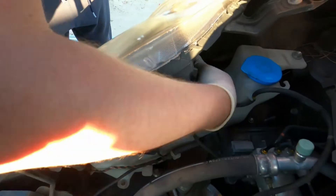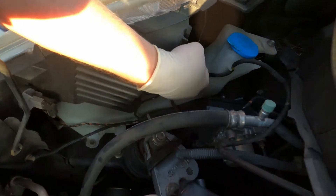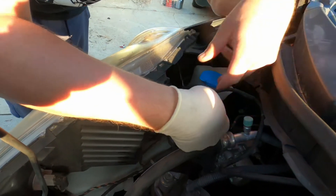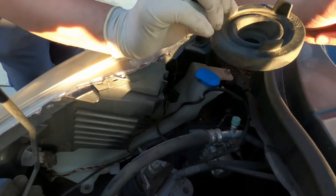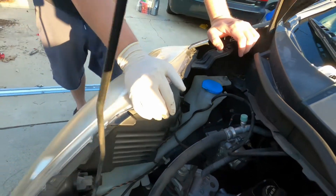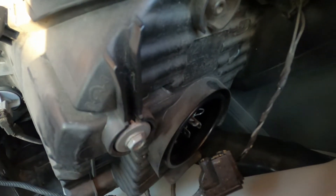So you're just gonna reach in, grab the plug, and unplug it. You can see there's a bunch of bulb grease and stuff in there. Then you're gonna grab the rubber boot and just peel it off. There's your rubber boot — put that to the side. Now inside here, on the back of the headlight, there's a clip that's just pressure — you just have to pop it with your finger and it'll flip out of the way and move the bulb.